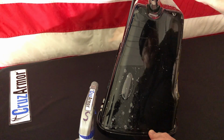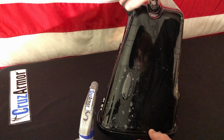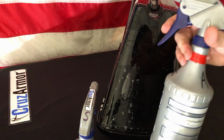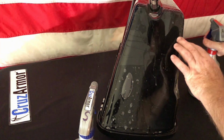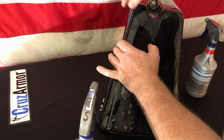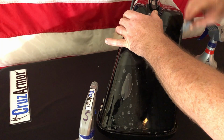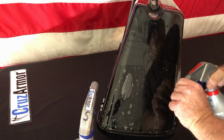and then try again. Now when you get to these upper areas, these should lay down fine, but if you find where you get a little finger like that, if you've made up an alcohol anchor solution, that's where you would use that, just for those little, what we call fingers, little places where the material wants to lift. And that alcohol will cause it to tack down aggressively and not slip. So over in here, we're going to do a little alcohol.